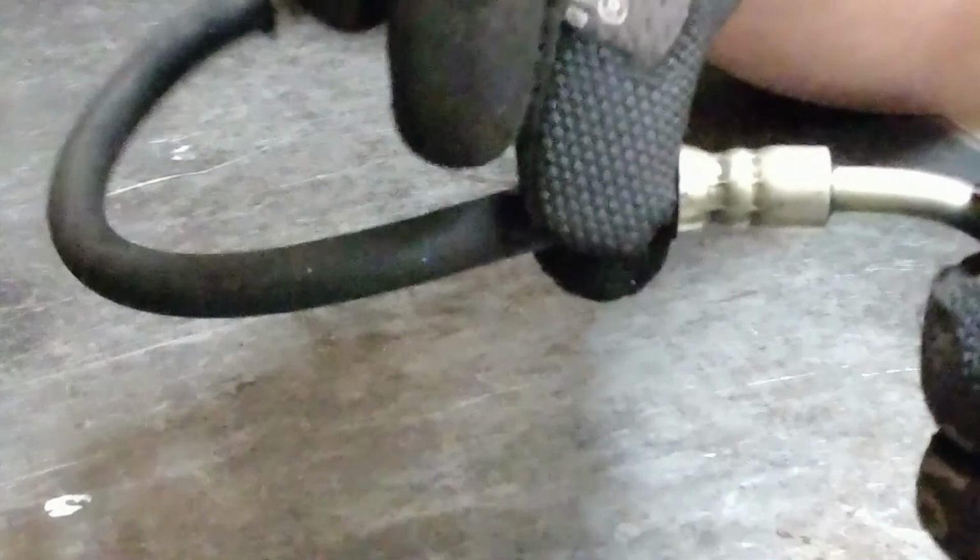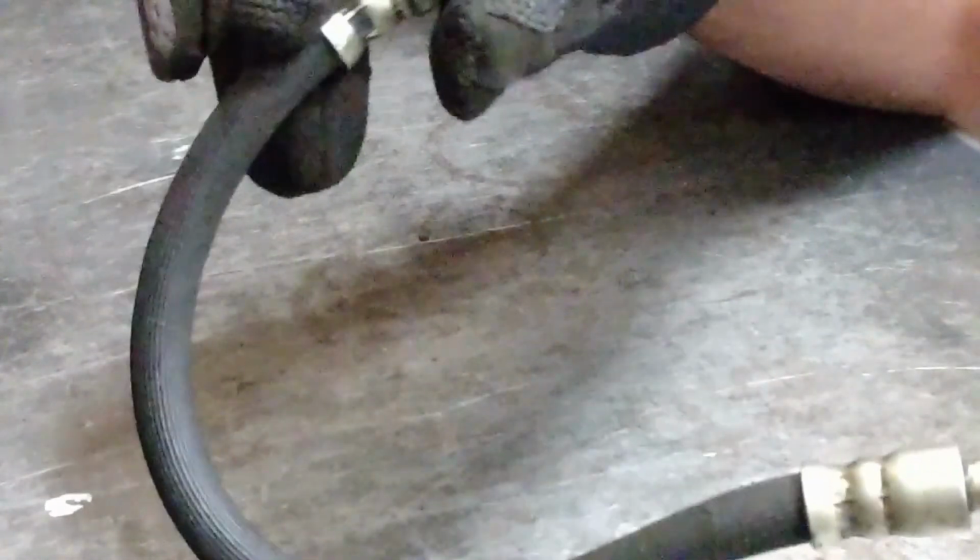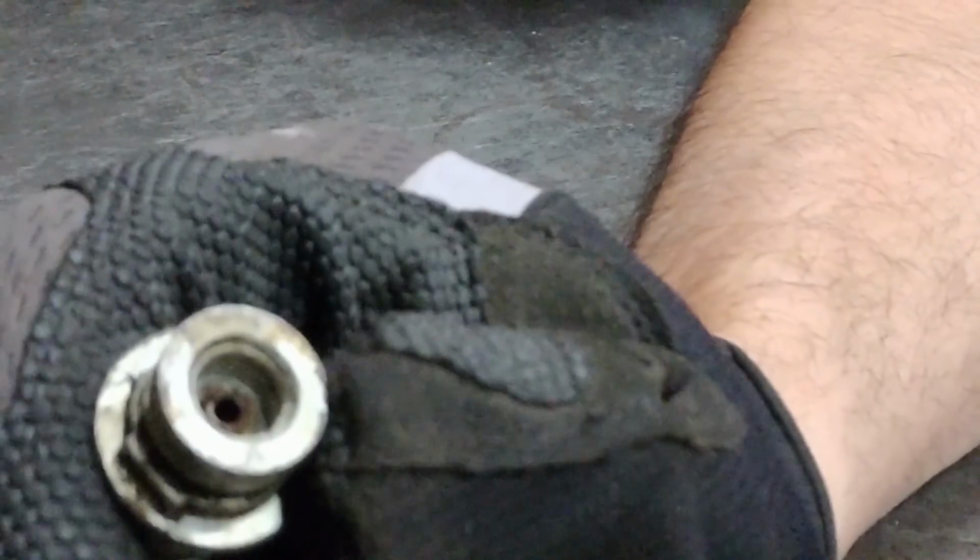Part of our visual inspection on the brake system is going to include areas like this, where we have a hard line that has a permanent crimp fitting to a flexible line. Flexible lines are used to get to places that are articulating, like on the suspension or the steering. This allows the line to be flexible and move with the suspension component while still holding the specifications for the pressure that it is supposed to withstand in the system. On the other end, there are fittings for the lines to connect to either rigid line, flexible line, or to another component.